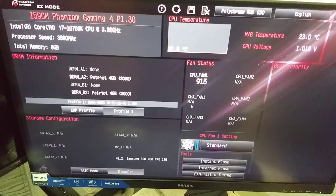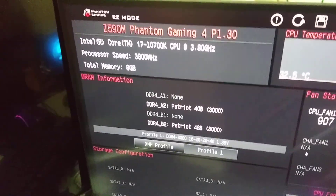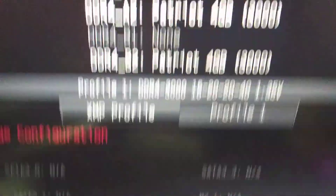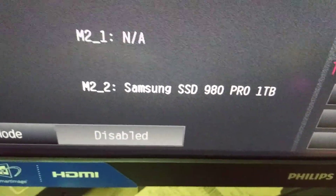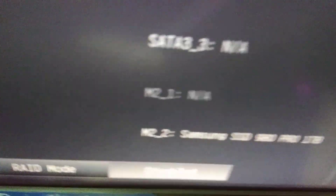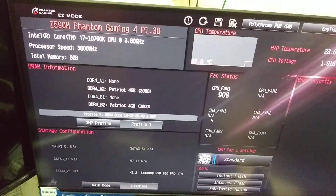There's ASRock — and it goes to BIOS, not Windows like before. With the 10th Gen, specifically the I7-10700K, this is what you get. There are your M.2s — it only recognizes the one, and that's the storage drive, hence why it's only booting to BIOS. When I had them swapped, it did recognize the operating system. So this PCIe 4.0 drive will not work with the 10th Gen — but it will work with the 11th Gen.